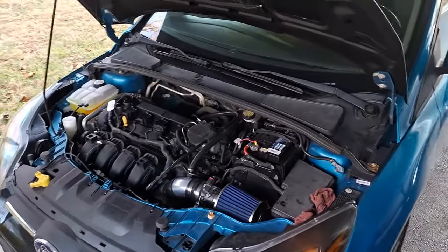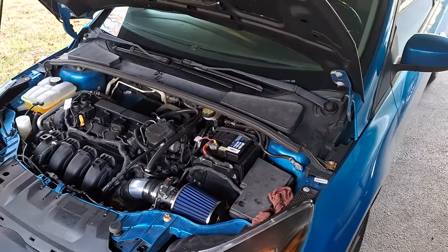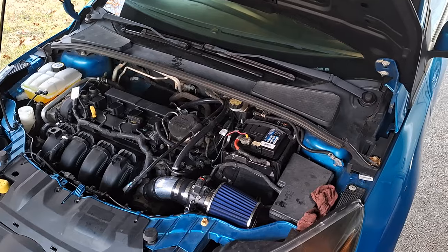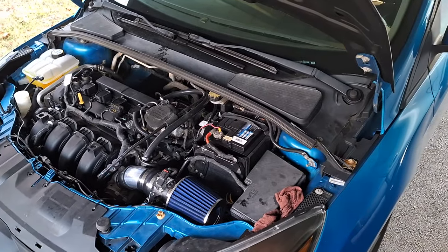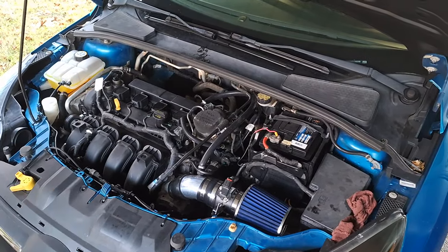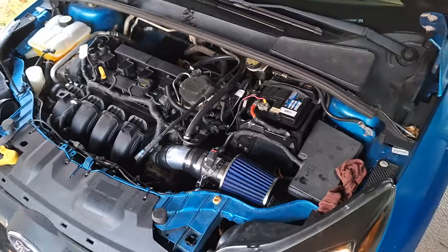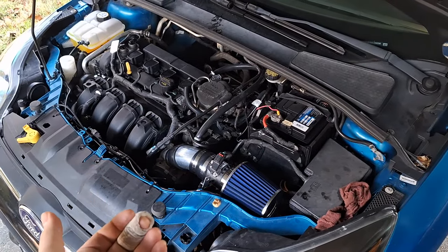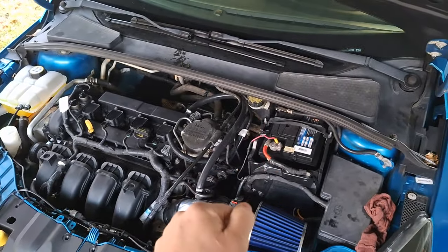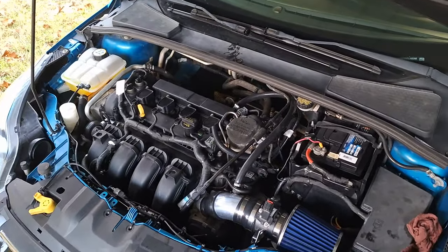If you have the 5-speed manual, congratulations, you have one of the most reliable cars on the planet. But still, with that manual transmission, I'll just touch base really quick. Once in a while, every few years, I would flush the hydraulics out for the clutch. The first thing that's going to go is probably the slave cylinder, and you'll lose your clutch pedal — it'll cause the pedal to go to the floor and the clutch won't apply. Once every few years, flush the clutch hydraulics and the brake hydraulics, because the brakes share the same reservoir as the clutch, and you don't want that dirty fluid to dirty the new clutch fluid.